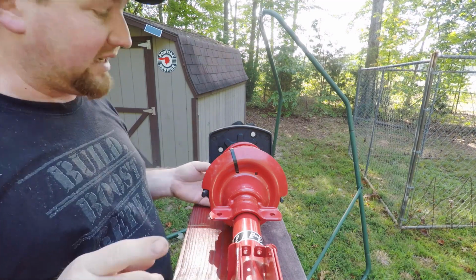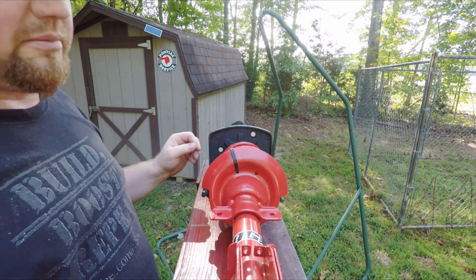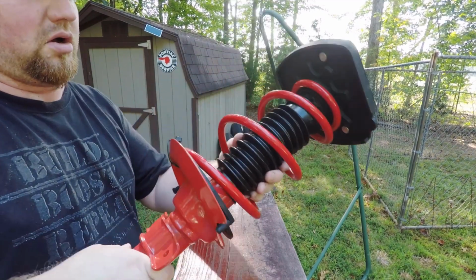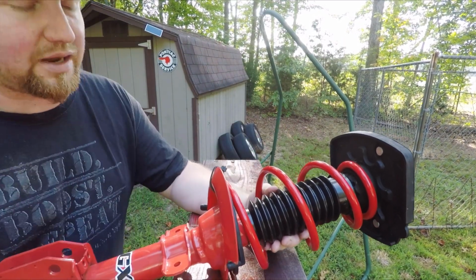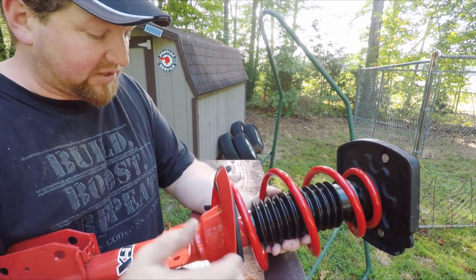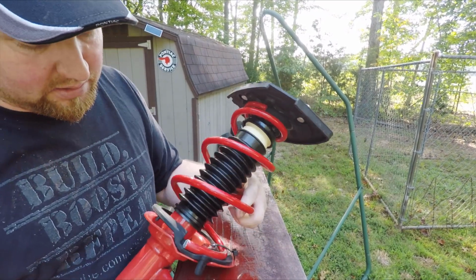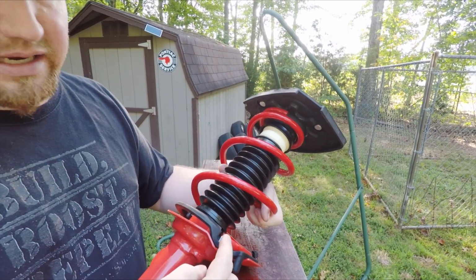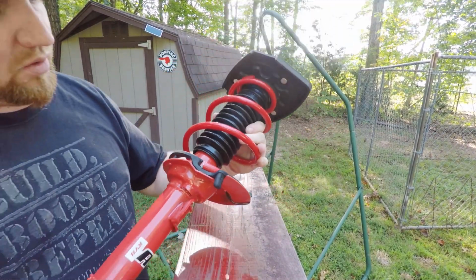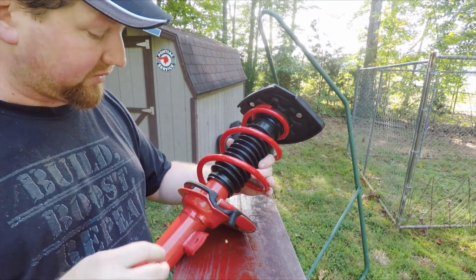The other problem though is, and if you watched my review of the DNA springs earlier in my channel, you'll know this already. The rear springs are too long stock because they will lift the back of the car up an additional probably half inch to an inch if you put them on like they are. So the first thing I did was cut one coil exactly off of this spring and then paint the end of the spring with a high temp paint so that that steel is not exposed.